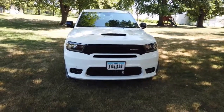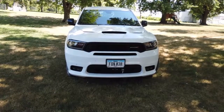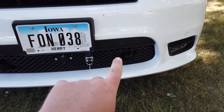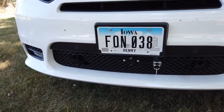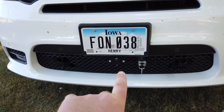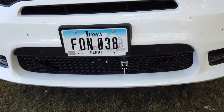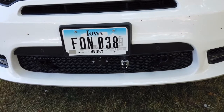We'll go ahead and do a walk around. I'll go ahead and show you the front side. We just had this installed yesterday. You can see our backer plate from where the tow bars connect into the rig, and also the wiring. It goes from a seven-way down to a six-way, and of course our emergency brake. It clips onto a wire, so if the vehicle comes loose from the motorhome, it'll automatically activate the braking system